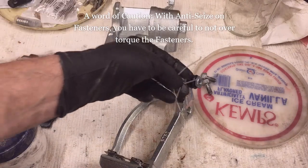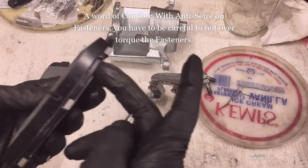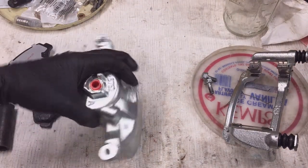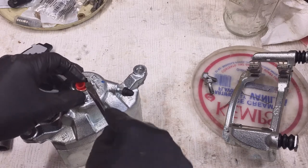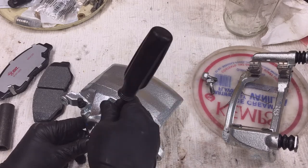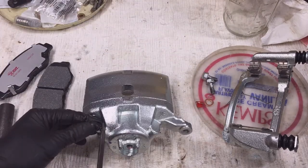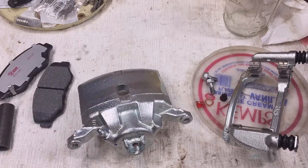Here's one of the reasons why you can't really load this caliper before you put it on the car — it's got these little spring clips to force the two pads apart. They go in the holes on the pad to give a little extra push to keep them apart. The new washers come with the new caliper, so when you're replacing the banjo fitting you get a couple of new brass washers. Take those off now so you don't have to do it on the car — it's kind of a pain. Then the rubber protective cap goes on the bleeder valve.